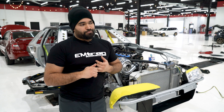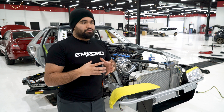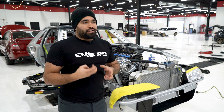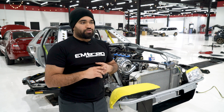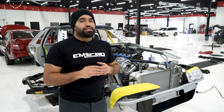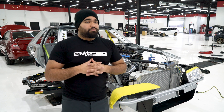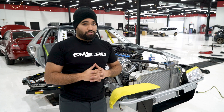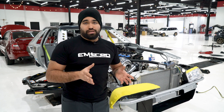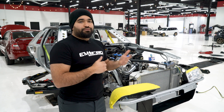For example, if you don't need 1200 horsepower on an autocross course, you can turn it down to 600 horsepower. We also have a flex fuel sensor. One of the changes we made was going to a surge tank setup for the fuel system — that helps the Weldon pump work more easily, since it's siphoning off the fuel tank rather than gravity-fed. The surge tank pushes fuel through the siphon, helping the Weldon pump last longer and preventing fuel starvation during high-G turns. This car on 315 Falken tires is probably going to pull some really high G's, so we were concerned about fuel sloshing. The flex fuel sensor also allows us to run 100-octane gasoline in a pinch — the fueling will self-adjust.